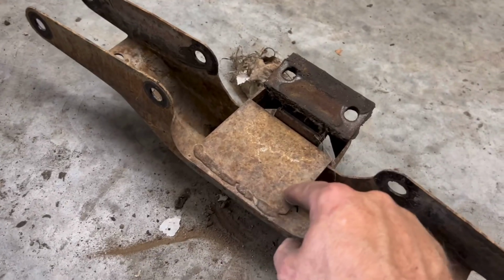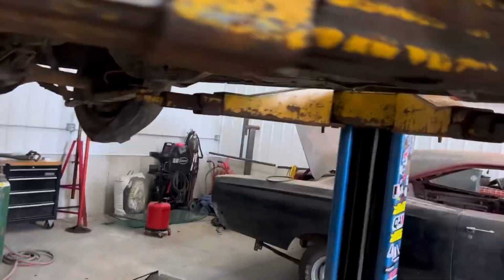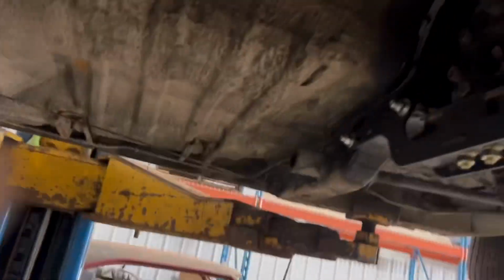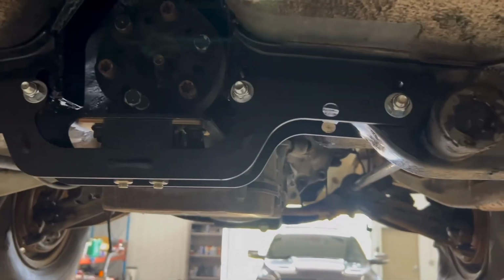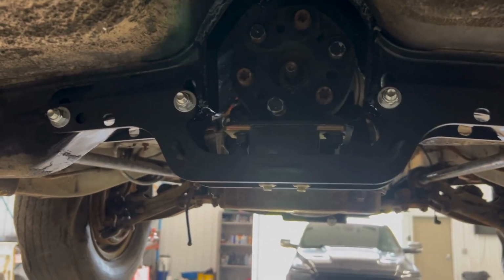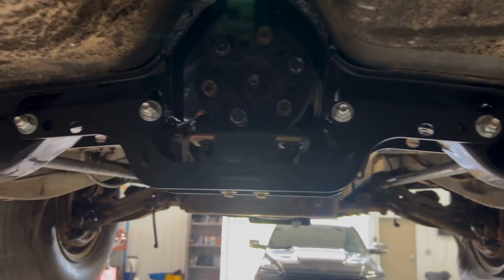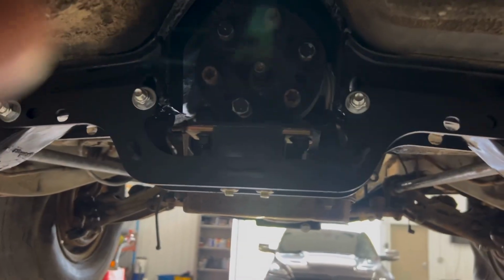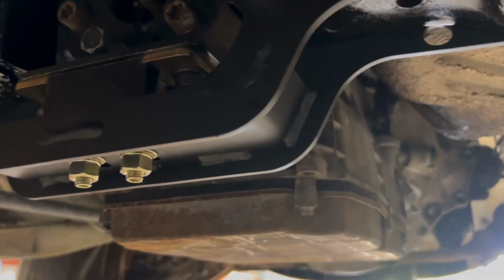In turn, that mount would have sat in there deep enough, giving you the proper pinion angle and the clearance all the way around on the tunnel. And you wouldn't be, I want to say that thing's $100-something. I know it is. And I'm sure for a 727, this thing works great. Sure it works awesome. A518, sure it works great. This Nag 1, way too bulky. That thing, nope. The height wasn't right.